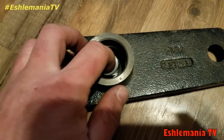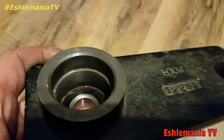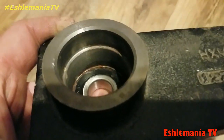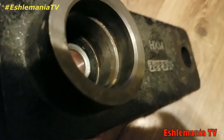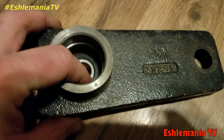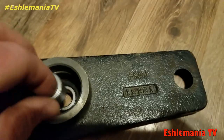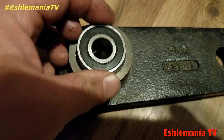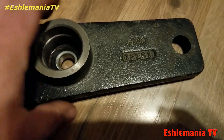Here is the arm, and this one's been out a while. Inside there you'll find the spacer and there's usually grease in here. You can even see on this one, if you look really close, there's rust down there — we cleaned this one out but there was rust in there because it got moisture in it, and that's what leads to bearing failure. You can see the rust on the side there. So what you want to do is pop that bearing out and replace them both while you're in there — put the first bearing in, stick your spacer in, fill up with grease around there, and then pop your second bearing back in.